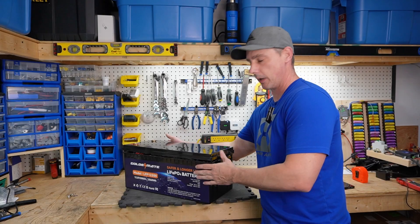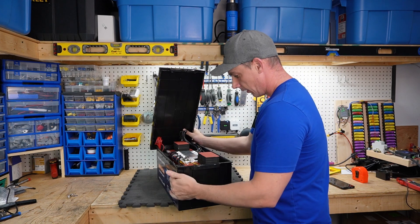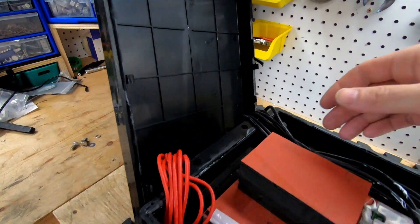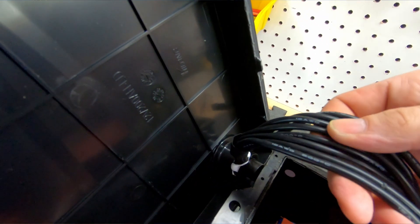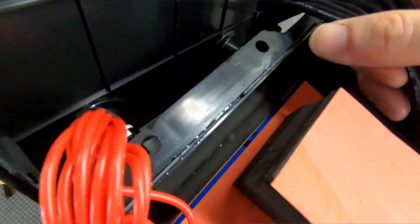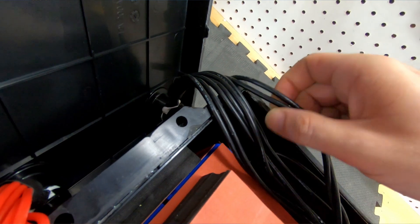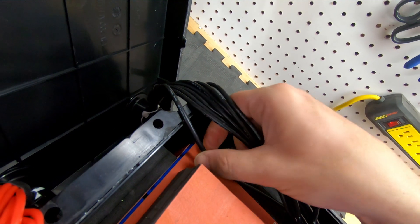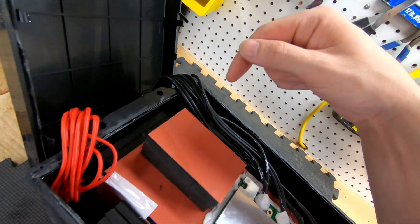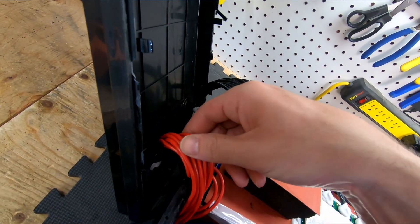These batteries are getting harder to open, but I got it cracked. There is a lot of wire in here — a rather big bundle. On the post it's covered and glued, so I'm not going to attempt to remove that, and the positive post is the same — capped and glued. Counting the wires: we have eight number 12 gauge conductors on the negative side. I'll put on screen what the equivalent single conductor thickness would be for eight 12-gauge wires combined.